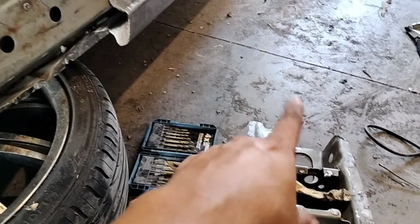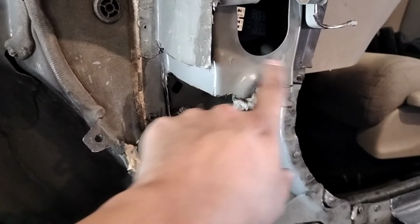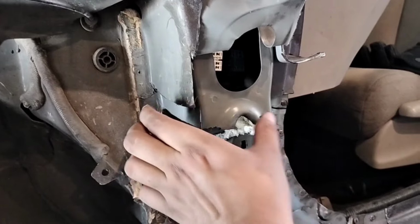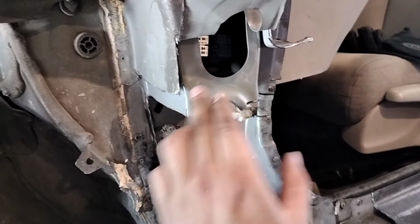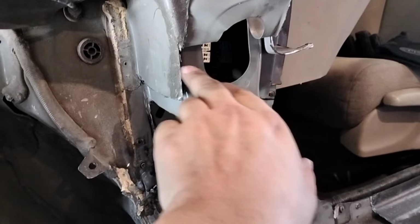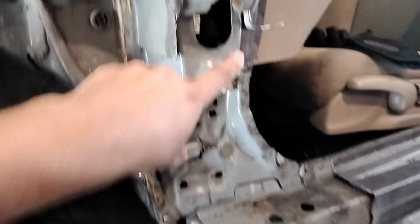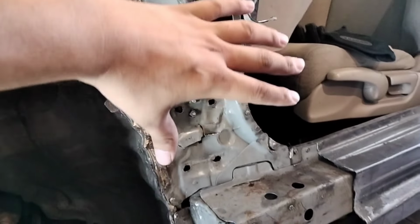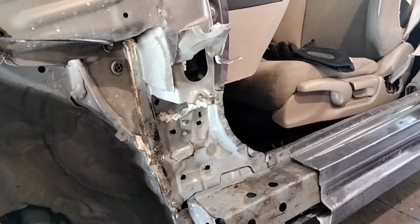Let's get started. Vamonos. Once this plate is off, we just need the outer skin, and then we're gonna do the opposite here. We're gonna take the outer skin and leave the plate inside, so this skin can just slide in there, if it makes sense, and then re-weld it. And then it'll be strong, and then weld our beam right there, our beam over here, and we'll be all right. And then do all the other spot welds, and then put the top sheet metal, and nothing ever happened. That's the plan.